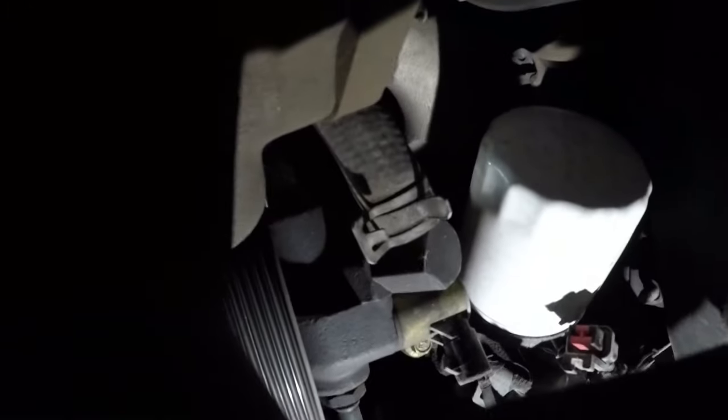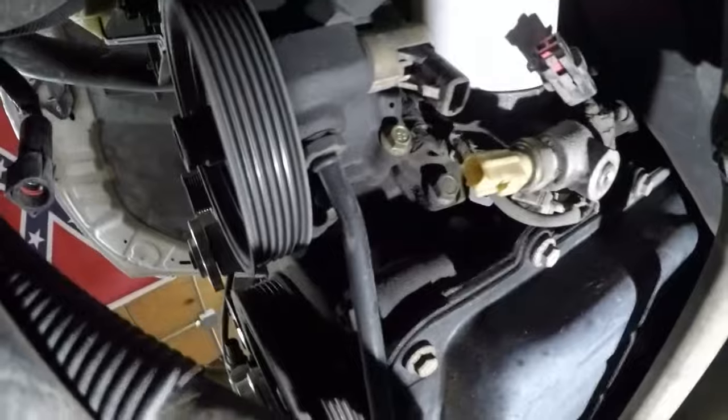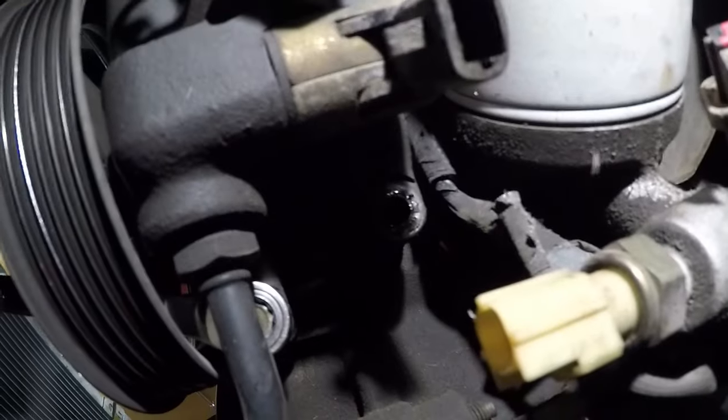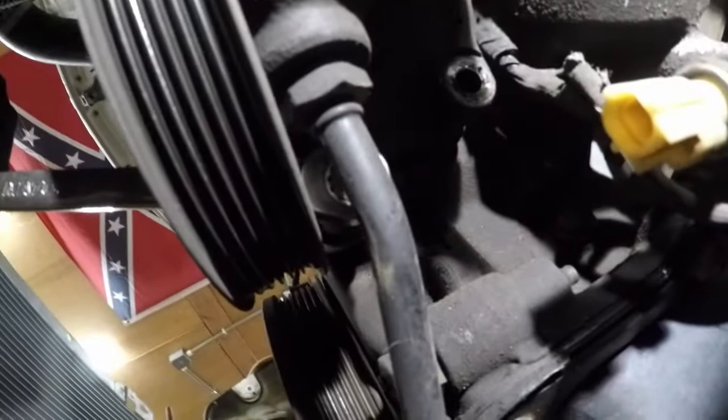So there's supposed to be two more up top and two down here. Got the four bolts up, the three other bolts out. There's one. Damn, this light doesn't quite shine on there. There's one there, it's half shadowed, sorry. I've got nowhere else to put the light. And there's two up top. I've got them. And there's one here, and the easiest way to do it is just put the 10 millimeter wrench through the wheel and get it there.